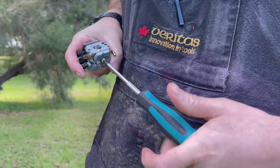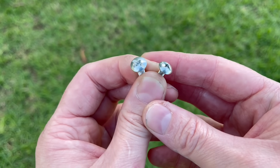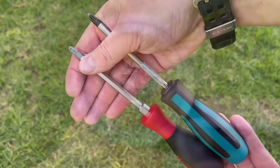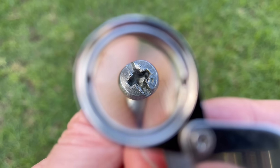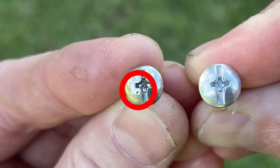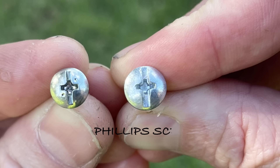There is one tool that I highly recommend you use — not just for this repair but anytime you're working on carburetors — and that is a JIS, a Japanese Industrial Standard, screwdriver. The hardware between a Phillips and a JIS look very similar, as do the screwdrivers themselves, but if you use a Phillips head screwdriver on JIS hardware there's a very good chance you'll strip that screw head out. One quick way to tell: if there is a dot present on the crown of the hardware, it indicates JIS; if there isn't a dot, it's Phillips. I've put a link in the description below if you want to buy one.